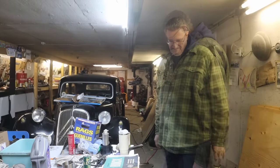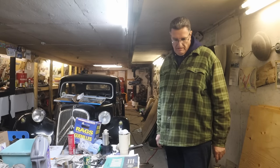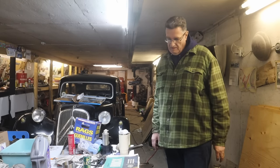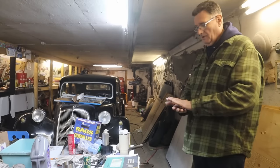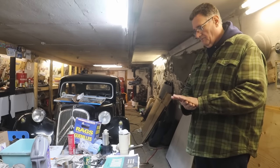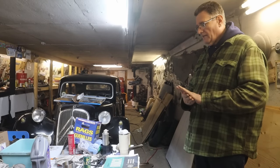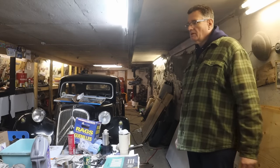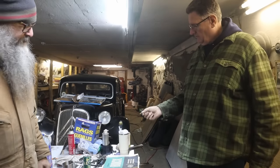That's got to change. I'll get the dual exhaust manifolds ready. And then the intake, there's a plug in the bottom of the intake. It's a metal sort of frost plug. Just make sure that isn't loose, because otherwise you're going to have a permanent vacuum leak. Wait till that has that nice four barrel on it sitting there.